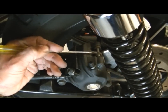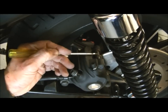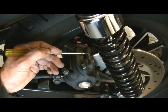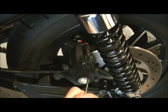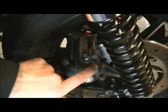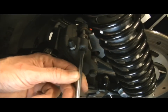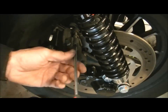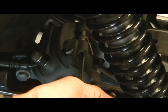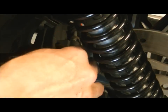That there and that are the two brake pads, either side of the disc, and here is your time-honoured pin that you get holding all brake pads in. So that pin needs to be withdrawn, and obviously there is the point where it goes in. Looking at that, it looks like it's a screw, but it's not. That's just a cap. All you do, pop a screwdriver in, make sure it's a nice tight fit. Just give it a little tap and you'll hear it crack. There we are, and it's nice and tightly seated. It's because it's on a flat seat.